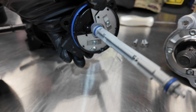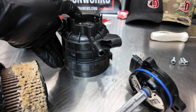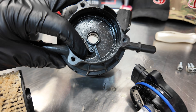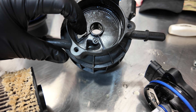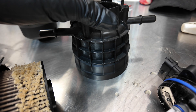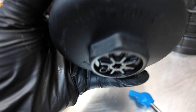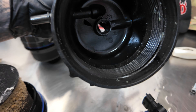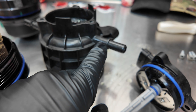This is the fuel heater assembly, and there is also a temperature sensor built into it. The housing is bolted onto the rail — fuel flows in here, swirls around inside, and gets heated up by the heater, then goes down into the filter. That's where it feeds into the outside of the fuel filter element. The water gets separated and drains to the bottom, and the cleaned fuel comes up through the middle and exits through that small hole at the center outlet.